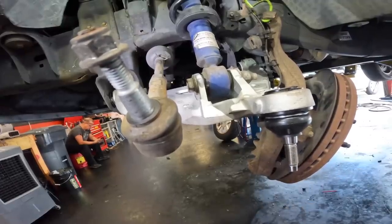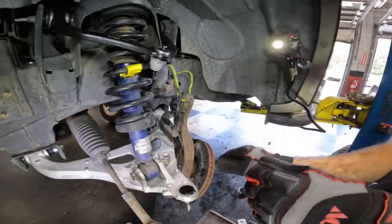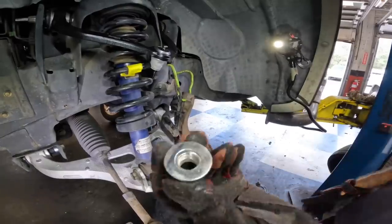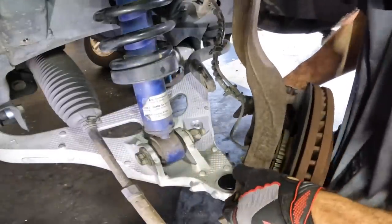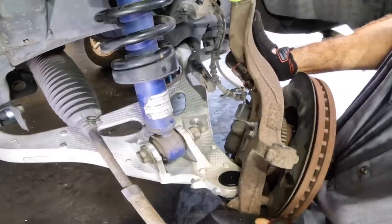Okay, I'm prepared to unhook the spindle here. We're gonna pick it up and pull it onto the lower ball joint down here, then once it's in, I'll reach down with the nut and tighten it up. I wonder if I can do this with this thing hanging. Oh, maybe I can. Is this gonna be easier than I thought? What? No. No way.